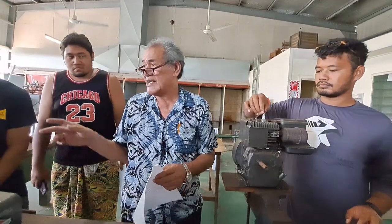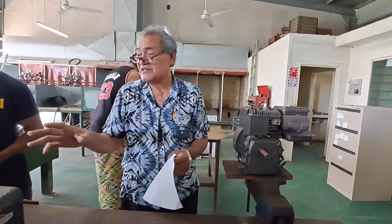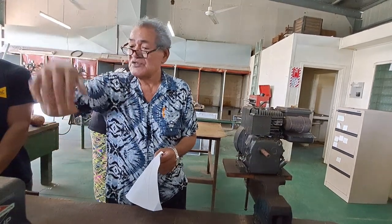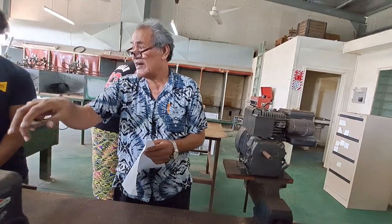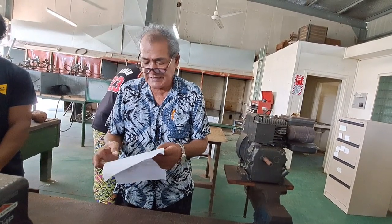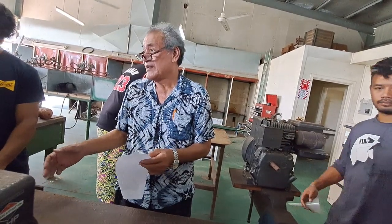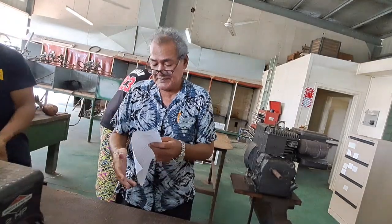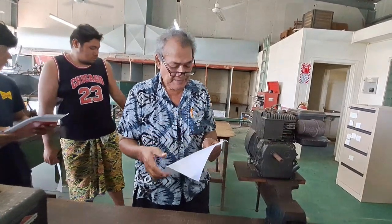Observe and record the kind of air filter. It's an oil-soaked sponge air filter. This one doesn't have the sponge in right now, but the sponge is soaked in oil and the air goes inside through the sponge — the dirt is caught and only air goes into the carburetor. Remember last week we had a look at the diesel engine — it had an oil bath air filter. Replace and tighten correctly — done.